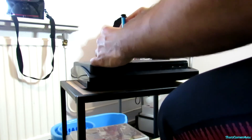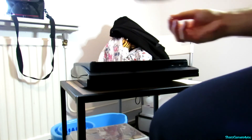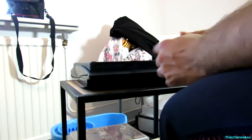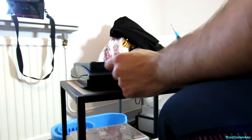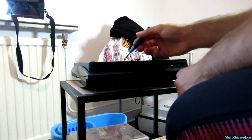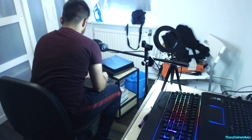Let's unscrew this. For the Slim, the hard drive is located somewhere here. You will see some DVD and Blu-ray logos in this area — that's where the hard drive is located. All you have to do is try to pop this up. Once that screw is out, this part should become loose. You just have to play with it and — there you go — it pops right out. It didn't break or anything.